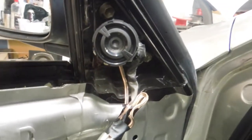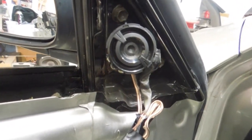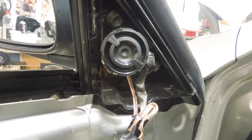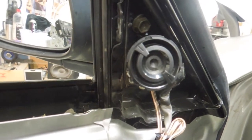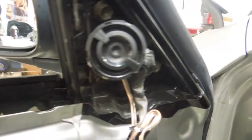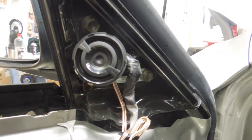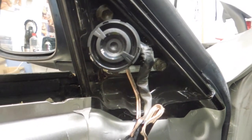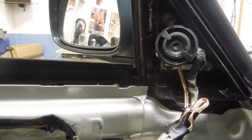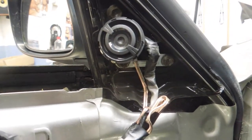The tweeter is mounted on the factory bracket. The way I've done that is just with a bit of super glue here and there to bond the two metal surfaces together — that's just a temporary thing. I've also run around the back of it with a good thick bead of black silicone RTV, and that stuff dries over 24 hours and sets really nice and strong. It sits rubbery but still bonds the materials really well, so that'll hold the tweeter in there nicely.